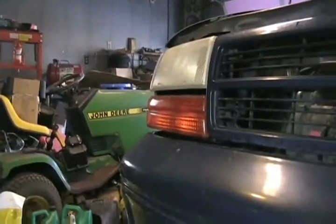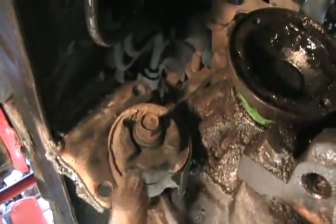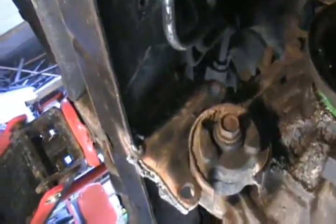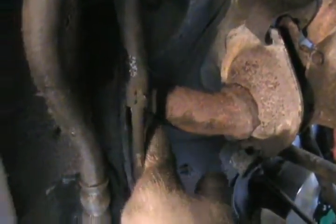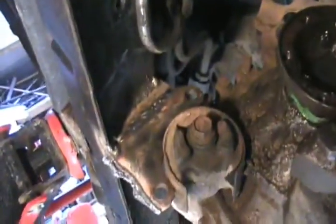If I crawl underneath I'll show you the only modification to the vehicle that has to do with motor mounts. On the back of the VW transmission there's a bolt hole — you put a bolt in there. This is just a rubber motor mount with a steel collar around it that came off some other car. I attached that to the transmission and welded a little bracket on there to the K-frame of the minivan — it's like a pocket motor mount. The rubber stops the vibrations from being transmitted to the frame. The purpose of that is because the exhaust is only about that far from the frame, and when accelerating, the motor twists back by torque and the exhaust rubs on the frame. The other thing I had to do was bend the power steering rack tube down a half inch — pretty simple.